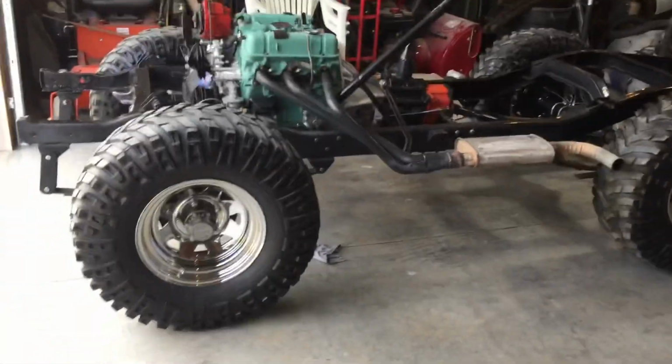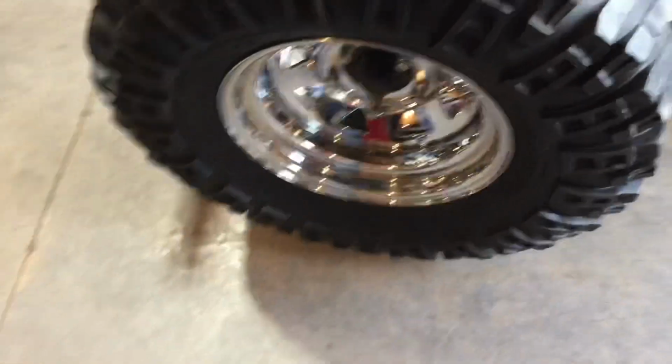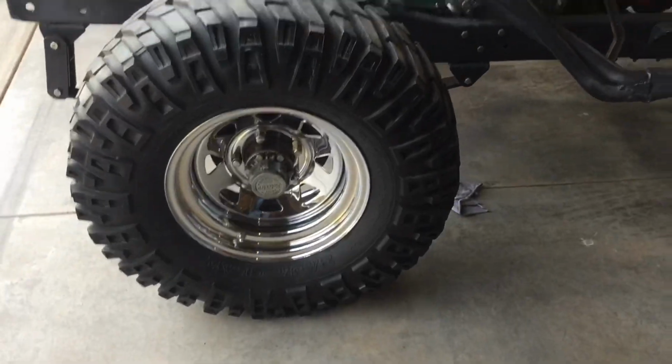Okay, all the Jeep wheels are cleaned up. Got the inside, outside. These are those 15-inch, 8-inch wide chrome wheels. Turned out real good. A lot of elbow grease. Use that Zephyr Pro 40. Found out on the inside had that, what I thought was oxidation. It's actually silver paint, but it was pretty messy. But anyway, I ended up using some lacquer thinner, cleaning it off, and then hit it with the polish.